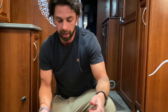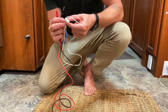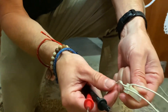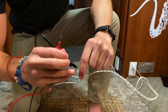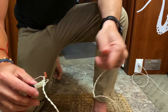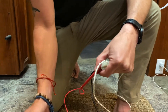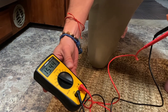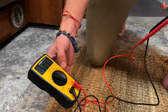In the palm of your hand you want to see it reading about 8 ohms. Two of the prongs are for your light and two are for the thermostat. Holding it in the palm of my hand I'm getting 16, and you can see that this is dropping — it's going to drop all the way down to nine or ten, maybe a little bit lower.